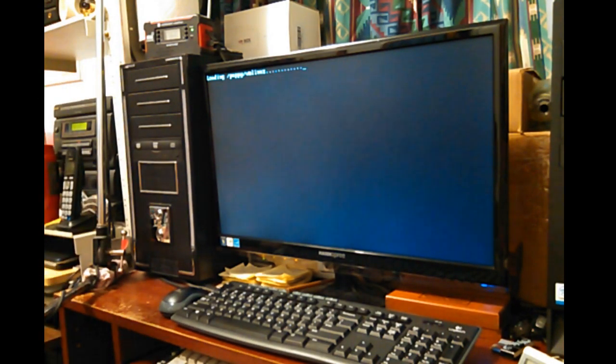Okay. Well, hard drive's bad. I guess I've really forgotten how long it takes to boot off a CD, because I went off and took a little break and came back and Parted Magic wasn't through booting yet, and I thought, oh yeah, that's really slow. Now I remember, CDs are slow. I'm just used to using USBs, and they kind of read faster than a hard drive most of the time.